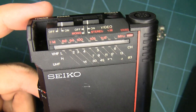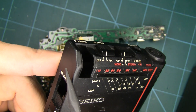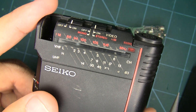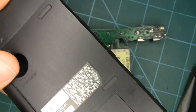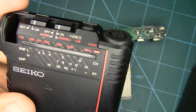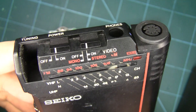I already took it out of the case — there's nothing special there. There are only two things to pay attention to: once the dial knob, there is a pin holding it in place. This thing moves upward and exposes the pin; when you move it out you can take it off easily. The other part is there are some hidden screws here and there, nothing that an attentive person wouldn't find.